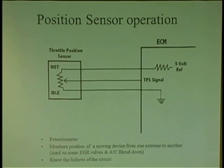That's like the guy who had a stuck thermostat, and the fan switch was actually in the radiator, so the coolant really never flowed to hit the sensor to turn the fan on. And he goes, the car's overheating, the fan doesn't want to come on. Dude, maybe it's the thermostat. You're playing around with the cooling fan and the coolant switch. You're getting too high tech. Keep it low tech. I went down here and felt the hose. I'm like, dude, it's cold down here. He forgot about the old stuff. So that's what I'm saying. Simplify it. Don't get too high tech.